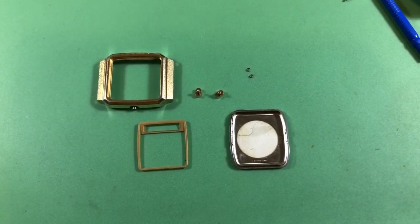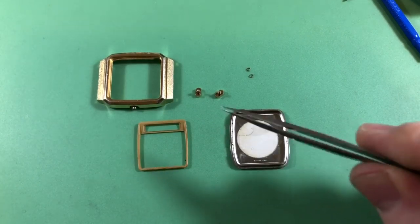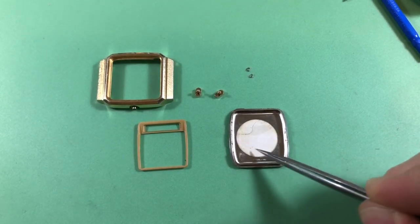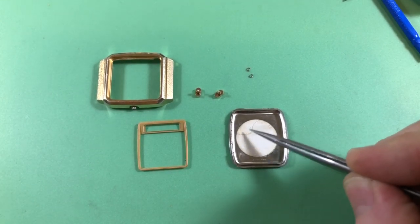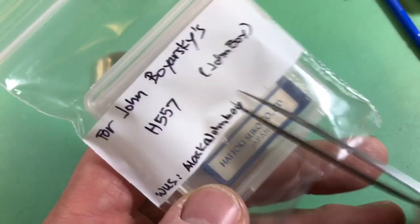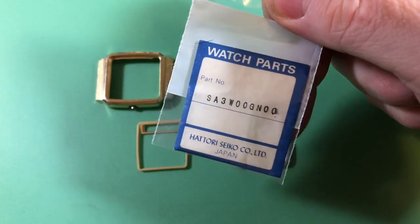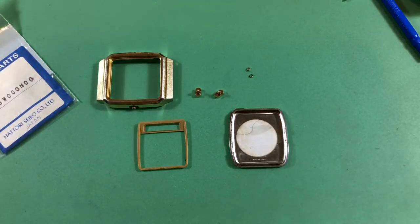My cold has not yet killed me — here we are, next day. Here's your case — you can see the basic case elements, the case back. There's a hair here that looks like somebody at some point glued this speaker conductor plate and a cotton hair got caught in it — I'm not going to remove it, it's not flapping around. Here are your buttons, your clean case, case back, clips — and of course here is the crystal. Kudos to you for tracking that down — brand new from Seiko, only a couple of decades late.